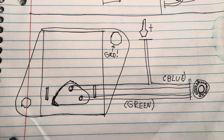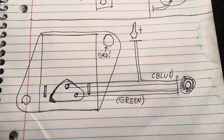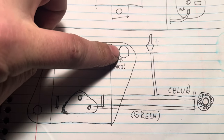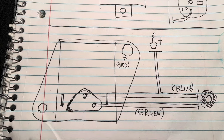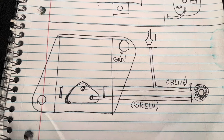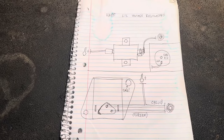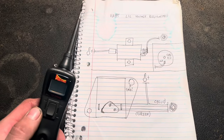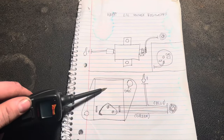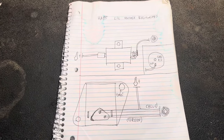In the case of the later style regulator, the ground is what is used to regulate the voltage coming from the alternator. The ground for this circuit is right here, so one very common issue is corrosion or rust behind this voltage regulator, or loose bolts, which cause a lack of ground and an inability to charge. If you have access to the power probe, it can be extremely useful for verifying all of this — you can even touch it right to the case of the regulator and make sure it's grounded. A test light can also do this.